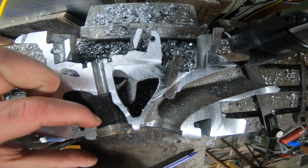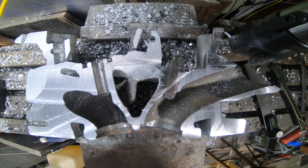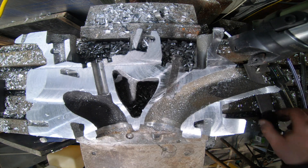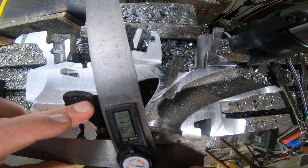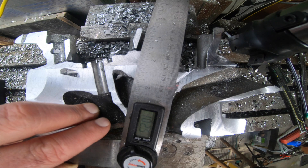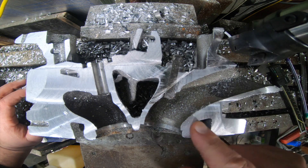We're about the midpoint for the exhaust now and we can see right at the tightest point about five and three quarter millimeters. You wouldn't want to reduce this much before you hit into the water channel, and that water channel does seem to go around — it's definitely directly connected to this gigantic hole right next to the spark plug, and there's water cooling right around the valve guide also. It's probably about twelve and a half degrees on the exhaust and the same twelve and a half degrees on the intake, so we've got about a 25-degree split between the intake and the exhaust valve.